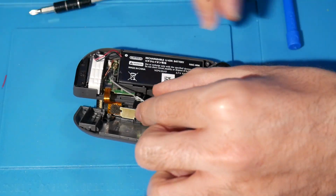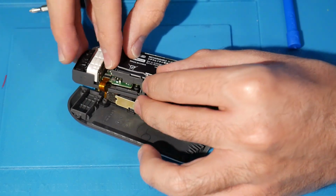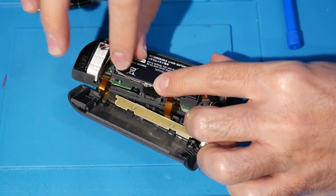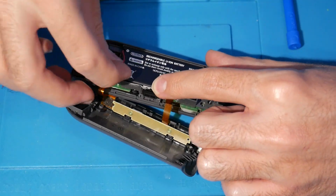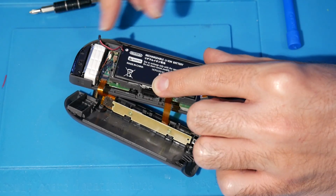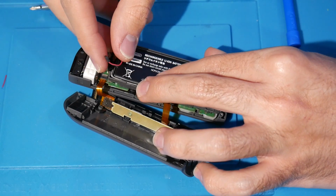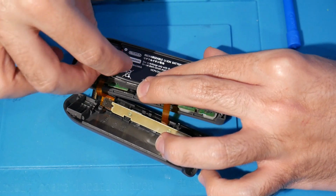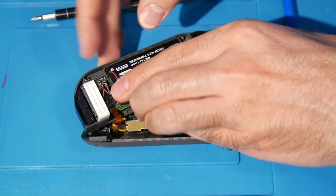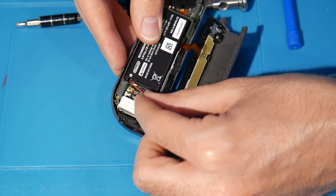I would say here, we did not disconnect the antenna, so what we can at least do is pop the antenna back in like this to make sure it's running against this here. And then when you plug your battery back in, what I recommend is you look at this, and there are 2 little notches there. You want to make sure they're facing downwards, down towards the little motherboard itself. And then from here, what I do is I just line it up, again, it's a little bit difficult to show on camera, with the connector on the board.